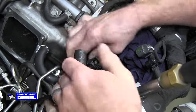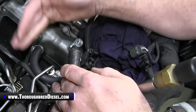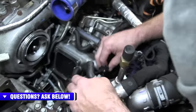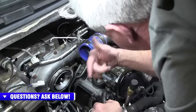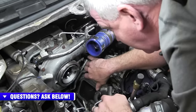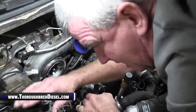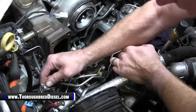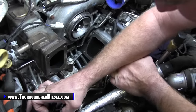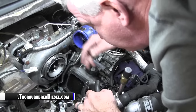At this point now, all we do is we bring our clamps down and tighten both clamps up, and this has our CP3 conversion side of it done. This is the point in your installation that you want to go back through and check all of the bolts that you unhooked, your bolts for your supply and return line factory side setup, the balance line bolts here and there. Recheck your balance lines. There is one bolt that we loosened here for this dosing line. We just loosened it to have some access to it. We want to tighten that back down. You just want to double check all your work here before you go with buttoning up the rest of the truck.